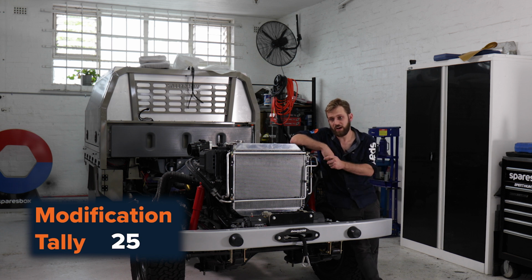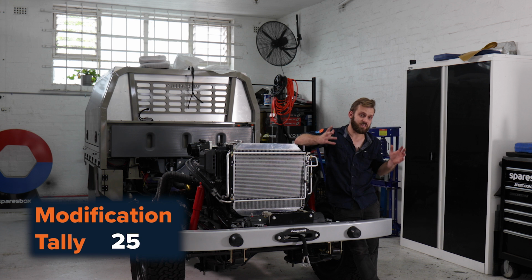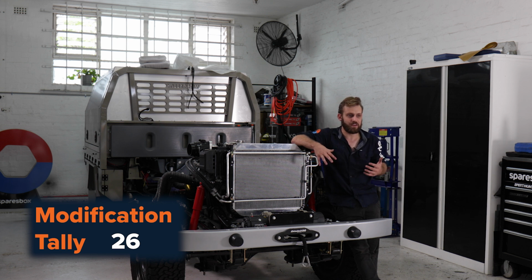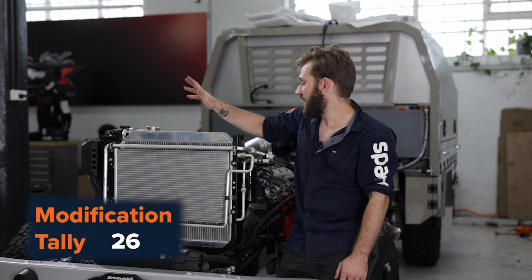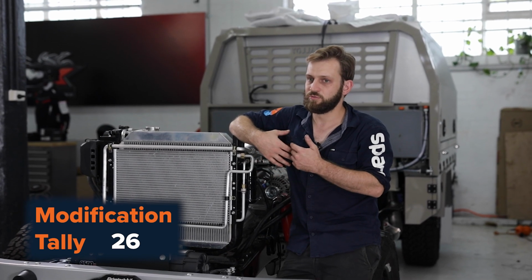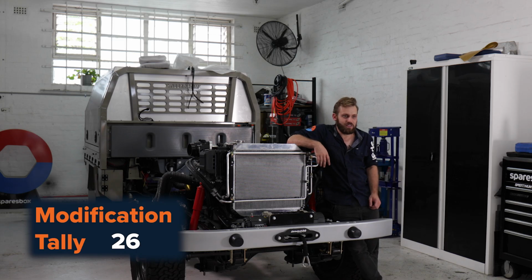With the fuel system in the car, space is really limited with the FJ45 chassis. The tank sits under the seats, under the cab, and there's not really much space for it to go anywhere else. So we actually modified the top of the tank to accept a Phantom EFI conversion in-tank pump and filter unit. It makes any swap like this a breeze. And we had the tank red coated as well, just to prevent any sort of rust or corrosion in the future of the vehicle.